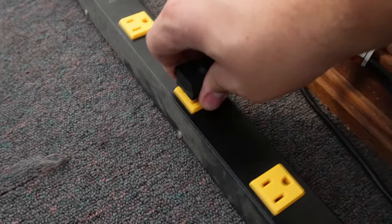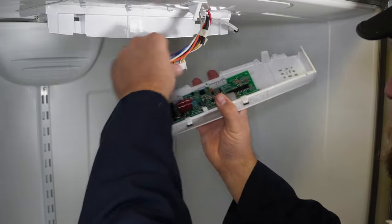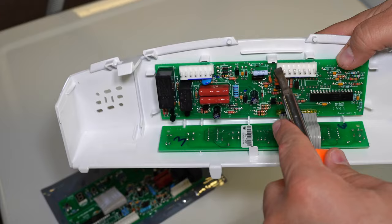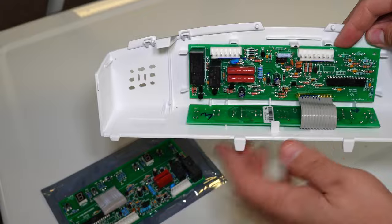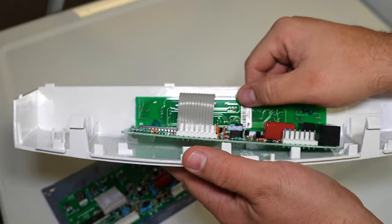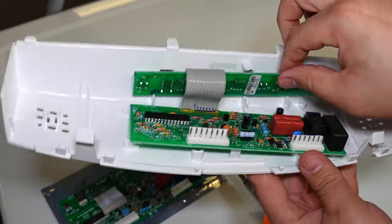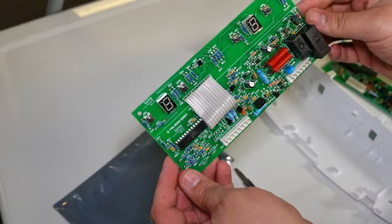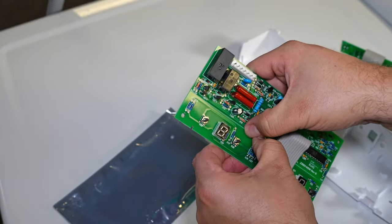Now, if you want to replace the board, first make sure the refrigerator is unplugged from the wall. Then remove the two wire harnesses that hold the board into place. The board is held in by two or three plastic retainers depending on the model and style. Use a flathead screwdriver or needle nose pliers to pull the plastic retainers up and away, then remove the board easily. If you need a replacement board, I'll have a listing for a third-party version online, which is a fraction of the cost of the OEM ones. I'll tag an OEM one as well in the description for a cost comparison. Typical replacement boards are one flat piece that you need to physically snap apart to separate the interface from the controller — this felt very odd to do, but that's how they are shipped and installed.